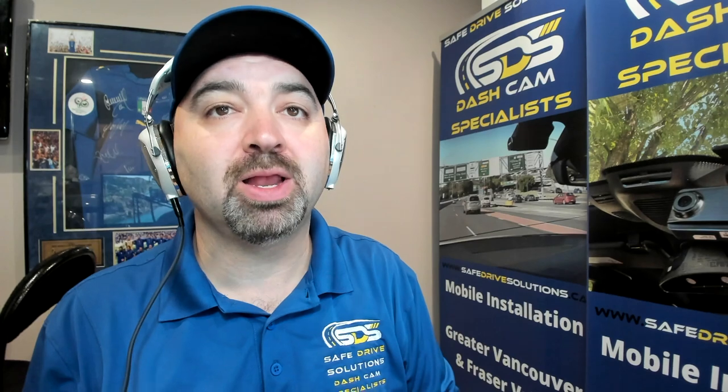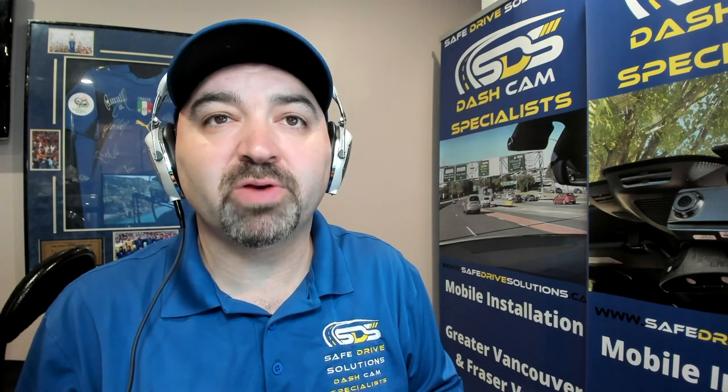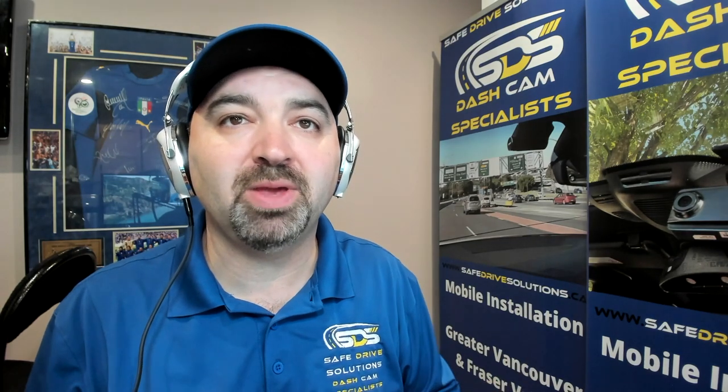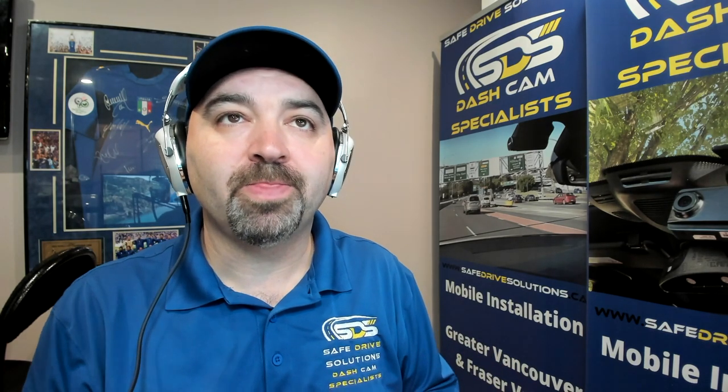Now you can get your 24 hours of parking mode. The big thing with all these power cells is to fully charge them — you typically have to drive about 40 to 45 minutes per day. So if you're a commuter, awesome, you're going to get it charged. However, if you're someone working from home and your day consists of a five-minute drive to get coffee and back, you're not fully charging it either. I really want to make sure that people don't have a misconception of what these systems do for you.